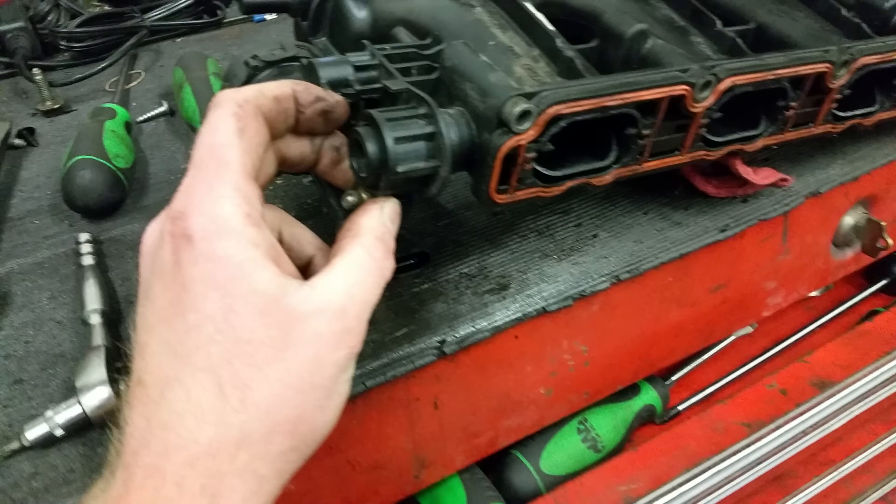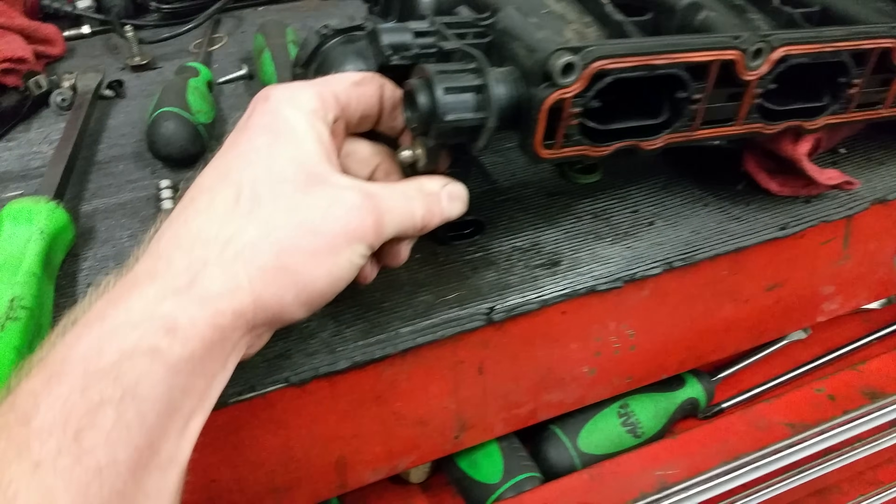The sensor at the end of this intake manifold was able to sense that the flaps were not in the position commanded by the arm, and this one did have a fault code for that.